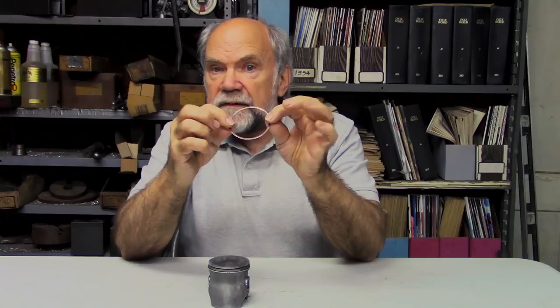The fact that the ring is pressed firmly down against the bottom of its groove and out against the cylinder wall by combustion gas is attested by the fact that the wear surface is shiny — that presses against the cylinder wall. And the bottom of the ring, this ring hasn't been in service for a while, but it's quite shiny on the bottom. And the top tends to collect deposits.